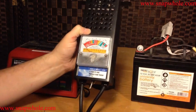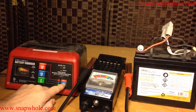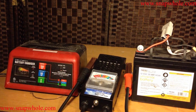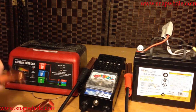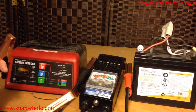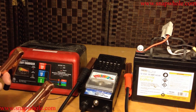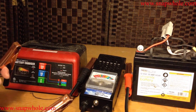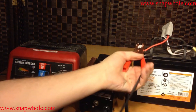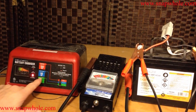So what do I do about that? When a battery comes in and it's weak, the first thing I want to do is set this to quick charge — the blue AGM, because that's the type of battery I have. The great thing I like about this charger is it's plugged in and turned on, but it's not live. Until it senses a voltage on the terminals, it won't supply power to the terminals. That works out really well, because otherwise you could put these together and have an accident without even realizing it. So I hook up red to red, black to black, and that's starting to charge.